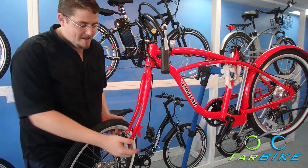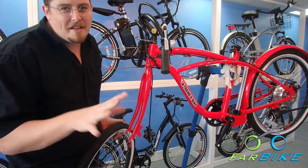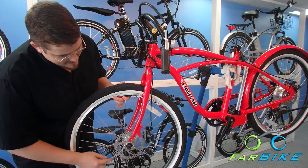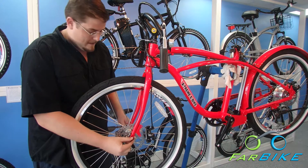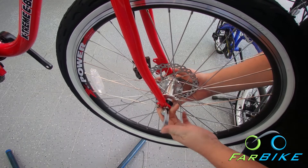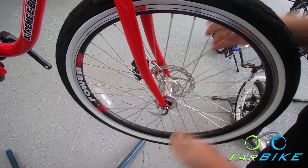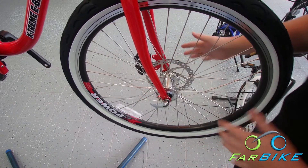On this bike, the front brake rotor comes disconnected. Some bikes have them connected, some don't — it depends on the model. Make sure your brake rotor is on the same side as the brake caliper and just pop it right into place. Once it's in, we tighten this black nut here until it's almost snug. Once tight enough, pop it in. If it pops in too loosely, the wheel will come out — it needs to be just right. If you tighten it too much, you won't be able to close it. You want to find the middle ground.